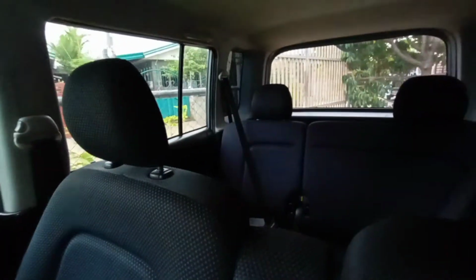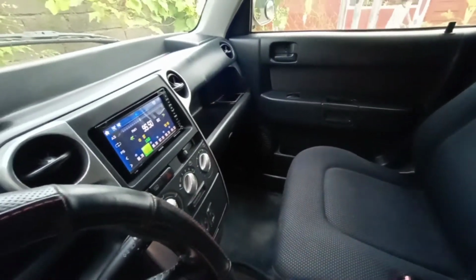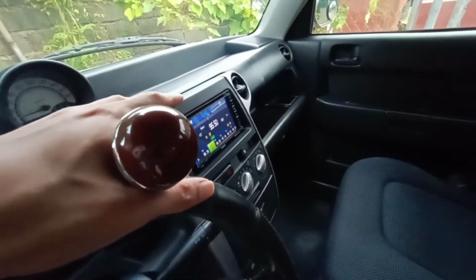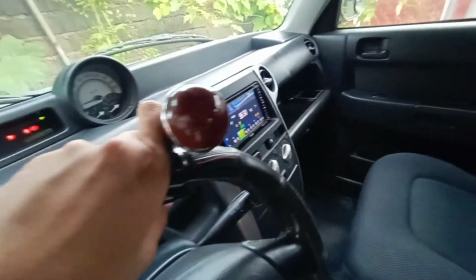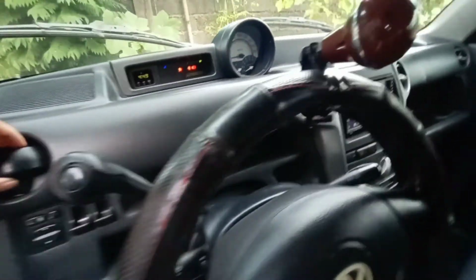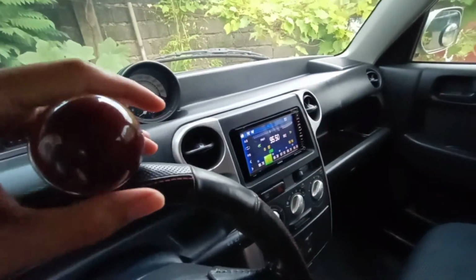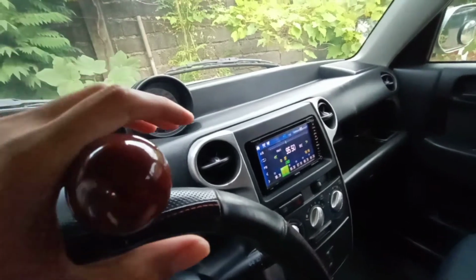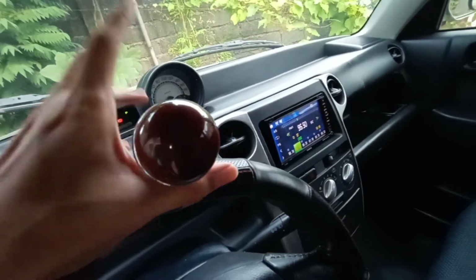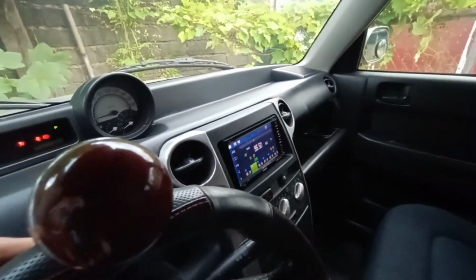The refrigerant leak is minuscule, so slow that over 2 months, it's right then and there you will just recharge the refrigerant. But most of the time, when I just sit this car under a week, no use, it will leak refrigerant significantly, so that I could feel the lack of air conditioning. So hopefully this helps. You just run it for about 10 minutes a day at least, okay? And hopefully after 3 months it won't leak or more.